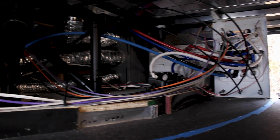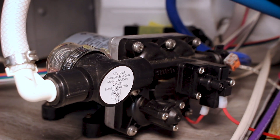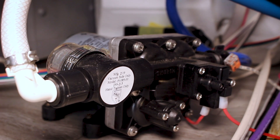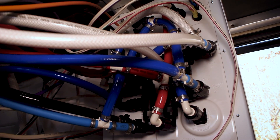Number three is pretty important — check the plumbing. This is an opportunity to check it in a controlled area and make sure that you have stores around you that can provide you materials if you have a water leak. A good way of checking it is to fill up the fresh tank and turn on the pump. The pump will pressurize the lines and you should hear the pump turn off. If the pump turns on again, that means it's losing water or pressure somewhere within the lines and you may want to check for a leak.